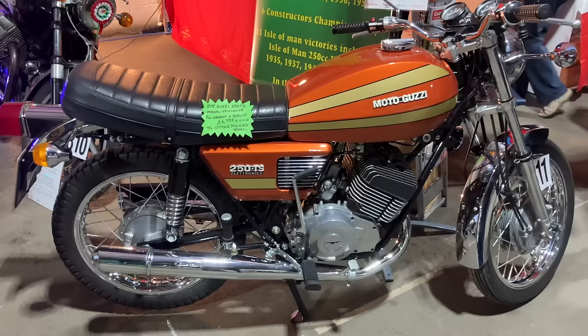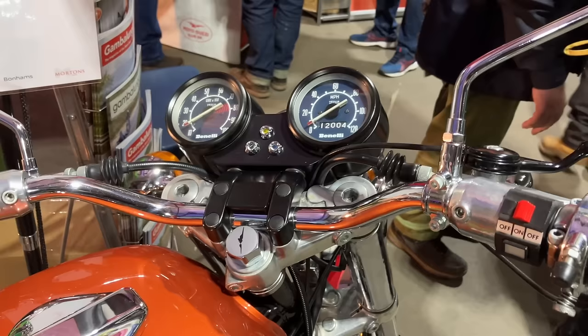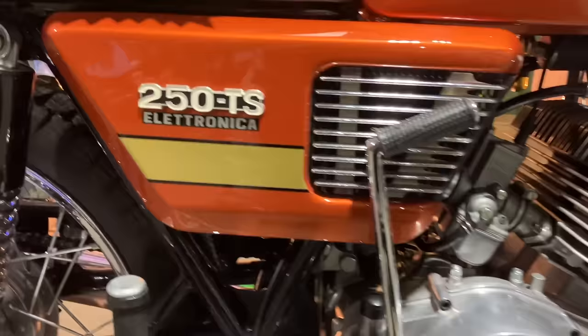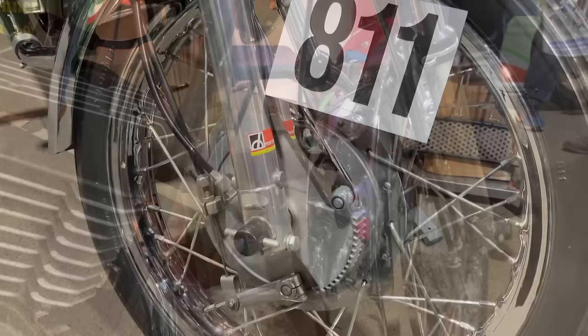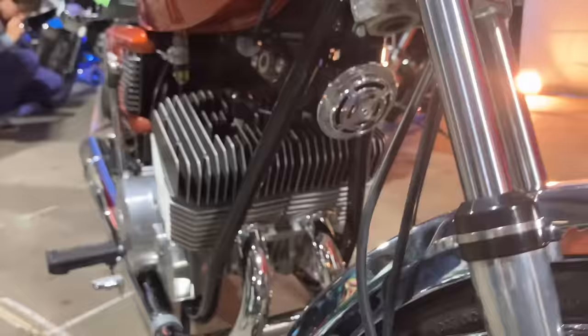The Moto Guzzi 250 TS. The Moto Guzzi 250 TS is very much a product of the time when De Tomaso owned the company, and is no more than a rebadged Benelli 250. The TS arrived in 1972, and is a 250cc parallel twin two-stroke engine, which unfortunately does not have automatic oiling, which the Japanese had of course made very popular by that point. But the 231cc piston-ported engine did make a claimed 24.5 horsepower at 7,570 rpm, and combined with its 137 kilo weight, made for a nimble machine with a top speed of 81 or so miles an hour — interestingly only the same as the Ariel Leader from more than a decade before.